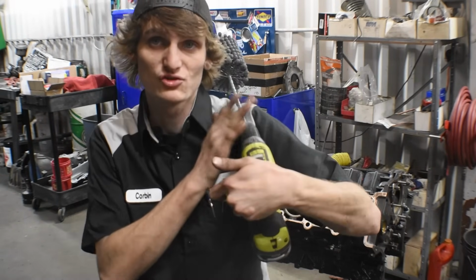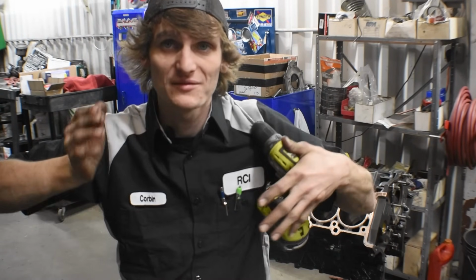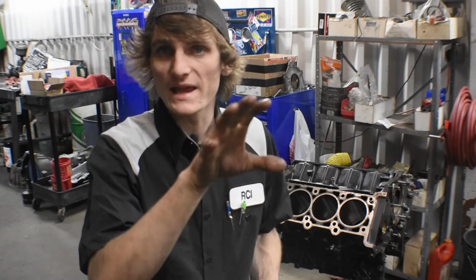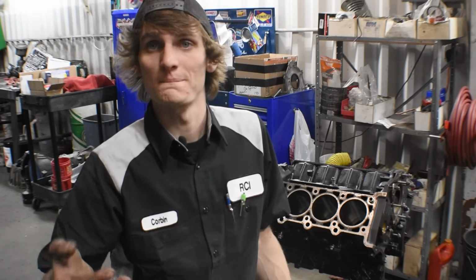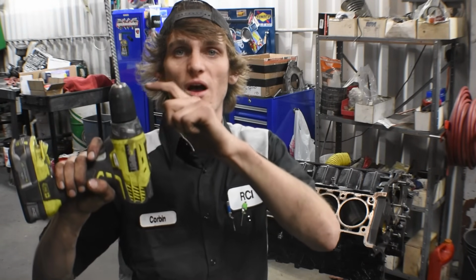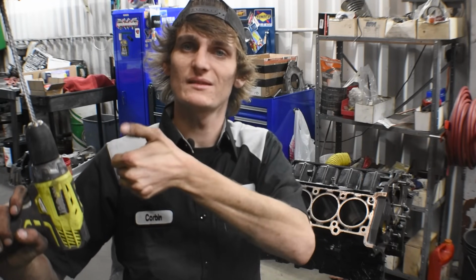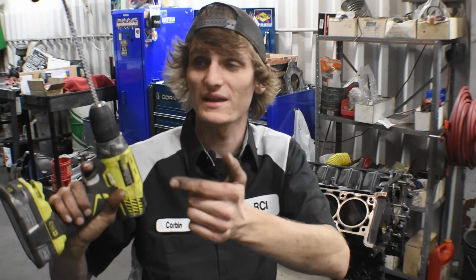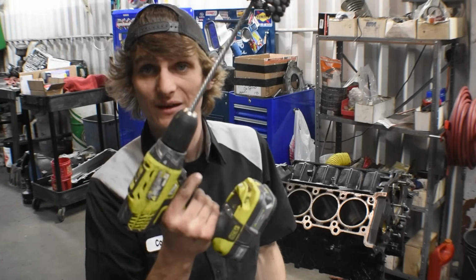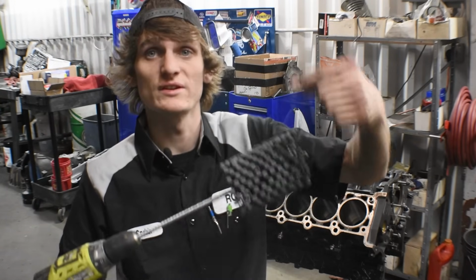What you need to do is have a drill that's anywhere from 500 to 800 RPM. How I did that was I took an app that I had found. It strobes a light at a specific RPM that you can set. On the app, I put it to 780 and then put a little yellow dot on the chuck. I adjusted the speed of the strobe until the dot stayed in one place while I was pulling the trigger. Now I know that this thing has a revolution of 780 per minute.